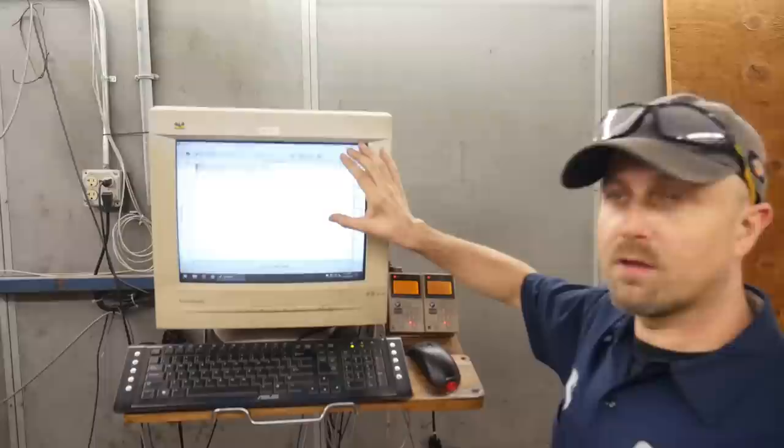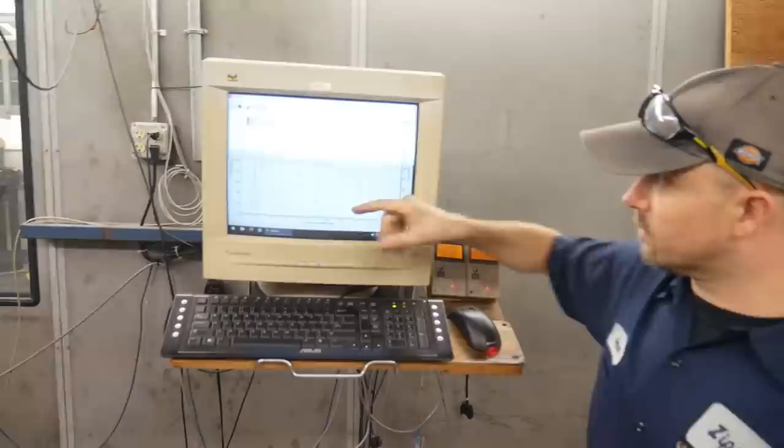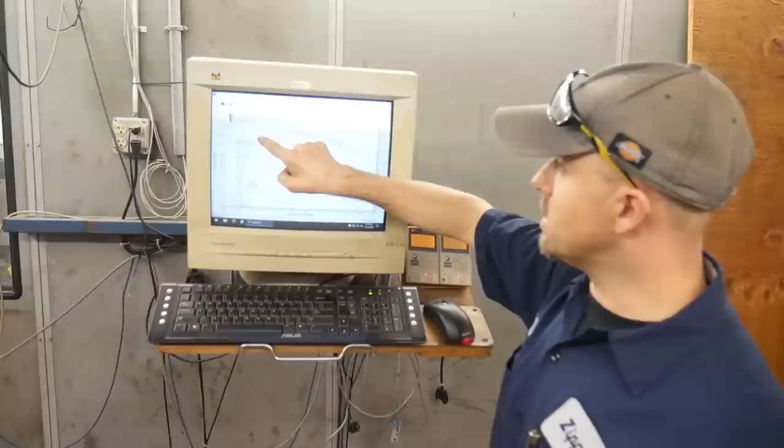By using the 472, we intentionally shifted the peak torque a little bit later. Now, I talk about early torque, and you've got early torque. We'll start talking numbers here. You hit 130 foot-pounds of torque at 1800 RPM. That's insane. So you have a lot of early torque. It's relatively flat in this area right here. If we had used a 468, it would have jumped up immediately and hit a lot harder here, and you would have had a real hard time getting traction.